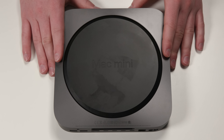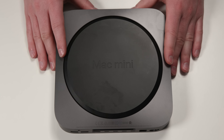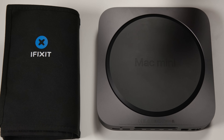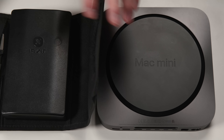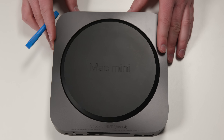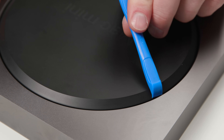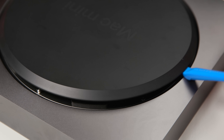That is not budging at all. There's a little clicking in there, which is good because that makes me think they didn't glue it. I don't think it's adhesive. So we're going to snag our iFixit ProTech toolkit — this video is not sponsored by them. It's an excellent kit and I use it all the time; I'll leave a link in the description. I'm going to use one of these little blue spudgers, which are plastic and very soft, and see if I can pry into the cover gently. That was a snap, and there's another snap — this thing basically just comes right off.